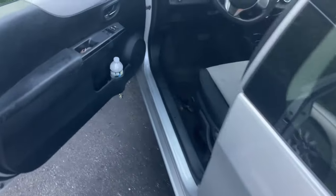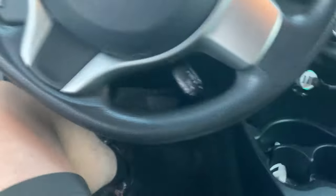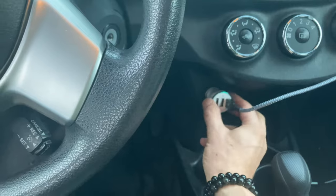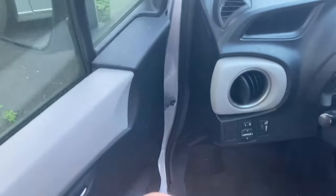What's up YouTubers — here we're in a 2012 Toyota Yaris. I'm going to show you: if your cigarette lighter or 12-volt has no power, the first thing you want to do is come down to the footwell. Right over here I'm going to show you where the fuse box is, and you check the fuse. If the fuse is bad, you're going to go ahead and replace the fuse.